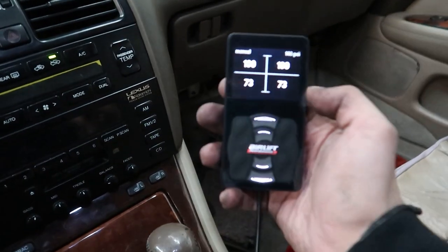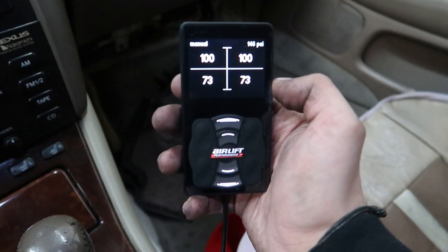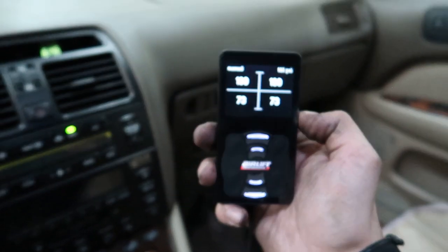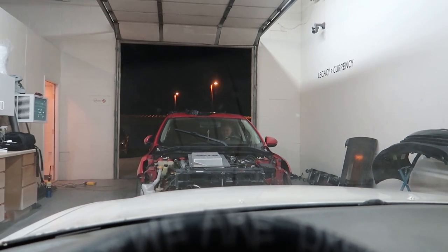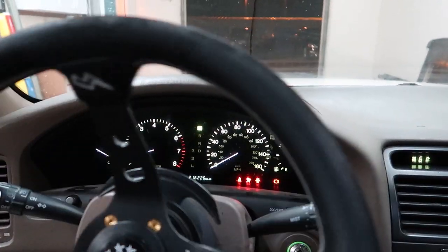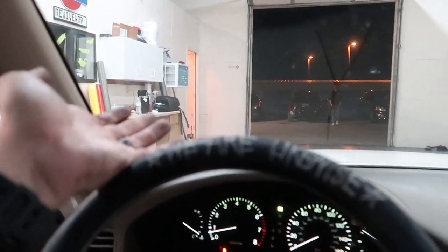Sitting in the car — this is what the remote looks like right now. We're sitting at about 100 PSI in the front and 73 in the back. This is probably the right height for now until we go into the remote and set everything up. We checked it earlier — riding at 100 in the front we do have full turn lock, we don't hear anything rubbing. The guys checked it and we are all good to go. We're going to pull this out and give you guys a look at how everything looks.